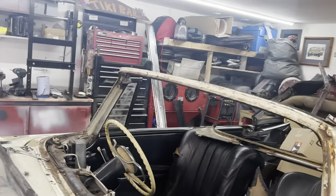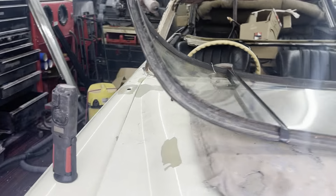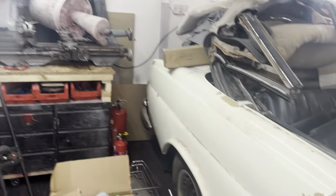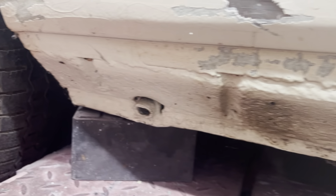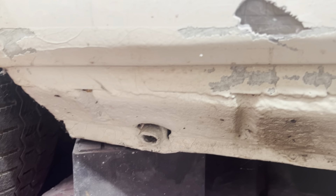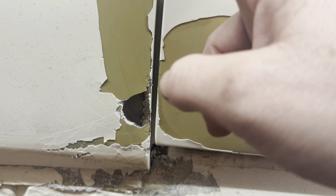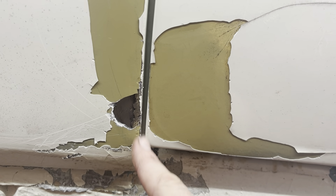Going around the other side, I've stripped a little bit where I took off the chrome trims - or I think they're chrome or aluminium. It shows where they've done a bit of work on the quarter panel. I don't know if that's how it's supposed to look, but it's unlikely - it's just been bogged. So what I'm going to do is use a one mill grinding disc, strip all this off, slit it down there and hopefully pull the panel out so it's a bit more flush.